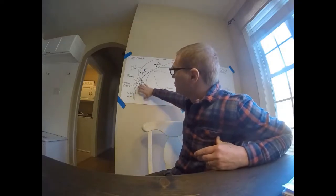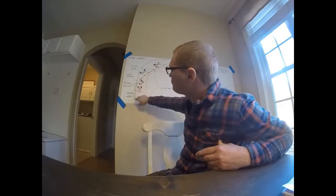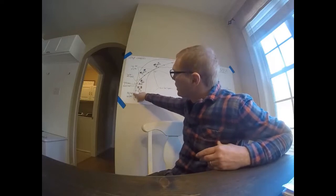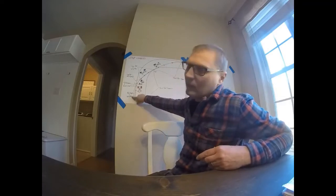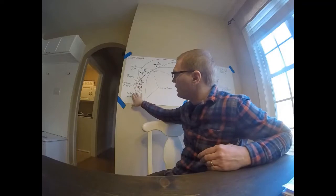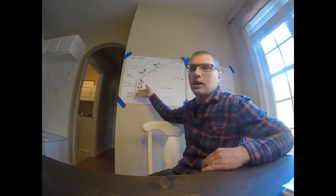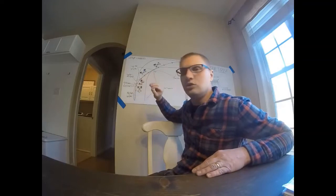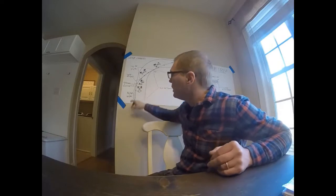I like to start my setup just like I would start the corner. I like to start in the braking zone. My priority as far as setup goes in the braking zone, I give priority to ride height, and then I use whatever spring rate I need to achieve the ride height I'm looking for. Again, this gets a little bit into roll centers. To oversimplify it, when I'm heavy on the brakes, I would like my nose or the frame of my car to just graze the ground in my heaviest braking.